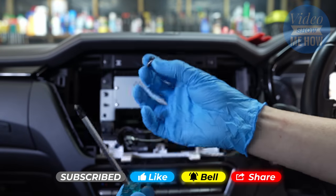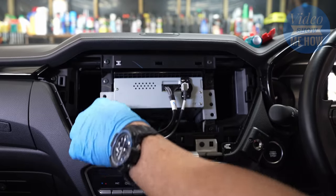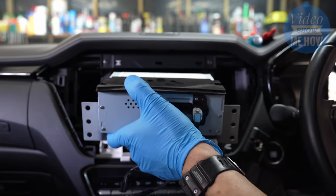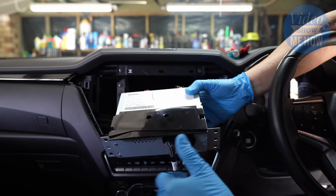Top tip here: make sure you use your other hand to capture the screw. You don't want it falling down the abyss because you're never going to find it again. Once we've got each of those removed, our next step is to get this guy out of there — just gently pry it out and be careful of the edges, as they are generally super sharp. You can always put a bit of cloth down here if you need to.